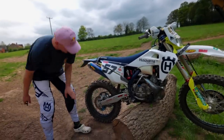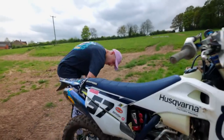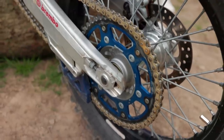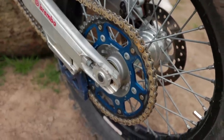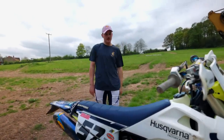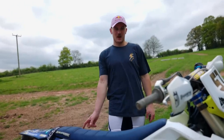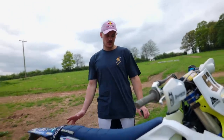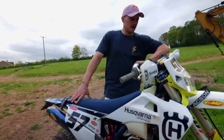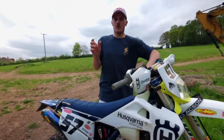Shock fin thing - also very important, you go through rocks quite a lot. XRM steel sprocket - super sprocks - a lot of rocks, gullies, roots, you need a solid sprocket. My gearing is 12-49, I think I've run that pretty much every race last year. I would actually quite like to go 48, but because of how short it would make the wheelbase I choose not to. That's why I use an XC first gear in my gearbox - just to try and make the ratio from first to second a little bit smaller, a little bit closer together.